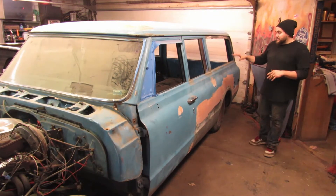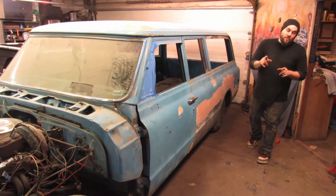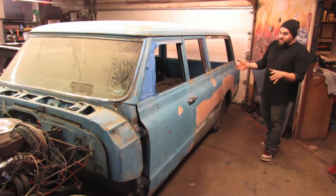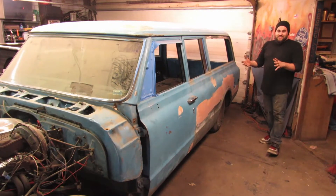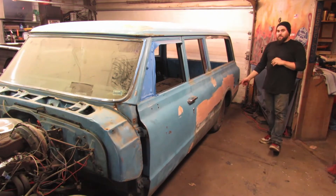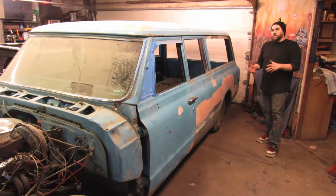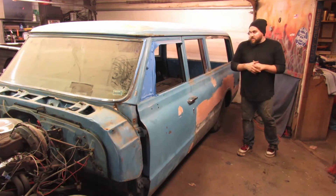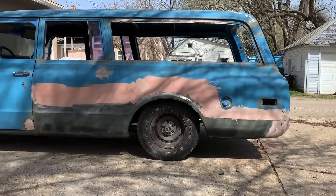I haven't done anything other than the bags — that's still a stock frame. I can do a little mini notch in the back to get about 3 inches more of drop, and in the front we can run a 3-inch drop spindle. So if I want to, I can get 3 more inches of drop out of it. I'm going to leave that up to the customer and send them pictures. I'm pretty sure they'll probably go for it — it's easy tricks. Throwing front spindles on takes an hour or two. The next video I'm going to be wiring everything up and running all my airlines. Thank you guys very much for watching — please like, share, and subscribe.